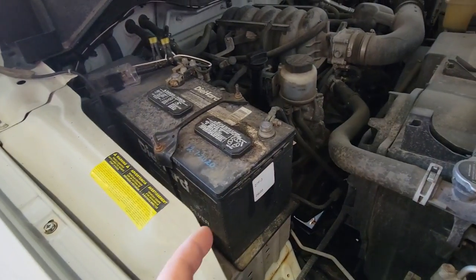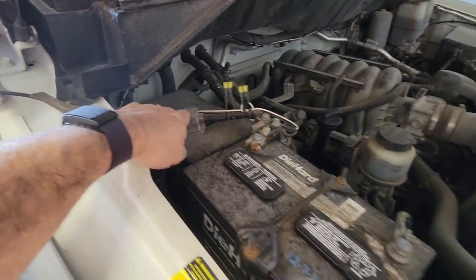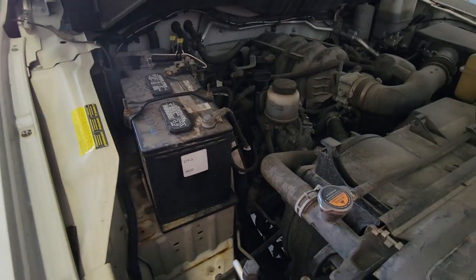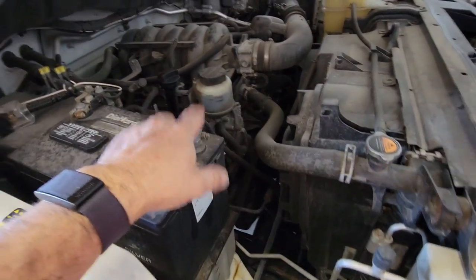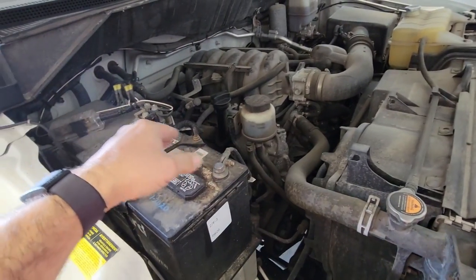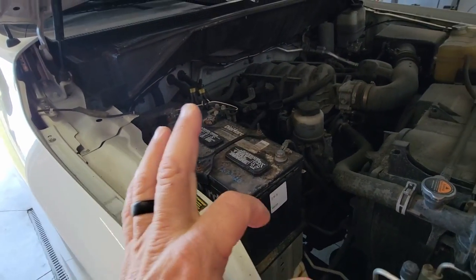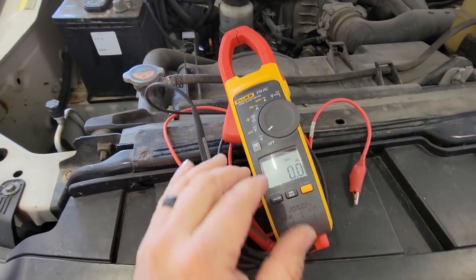I have a power inverter in the van — there are times I leave it on over the weekend and it can be dead when I come back, so I just need to get it running again. What we're going to do is unhook the negative, hook the battery jumper cables right to it, and trick it with 12 volts from the current battery so it thinks it's got 12 volts. We're going to see how many amps it actually takes to start this truck using the DC inrush capability on the Fluke 376.